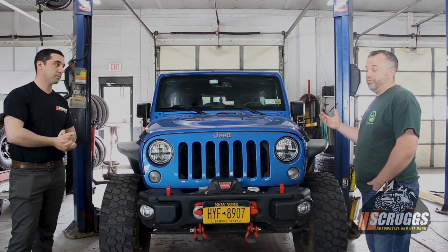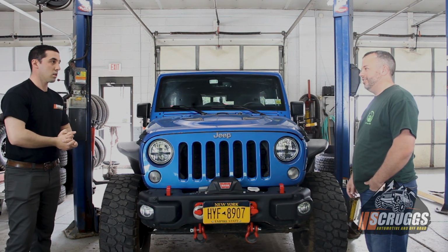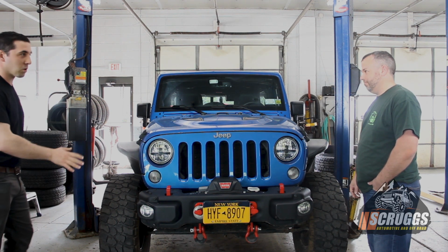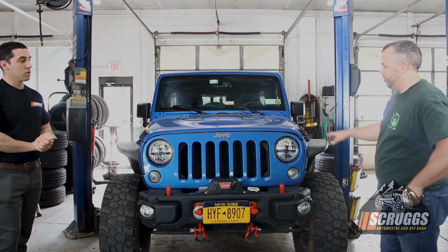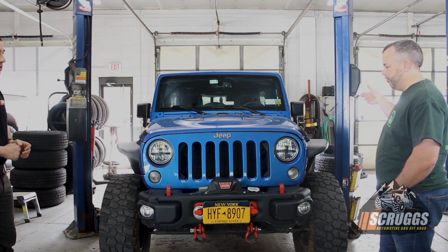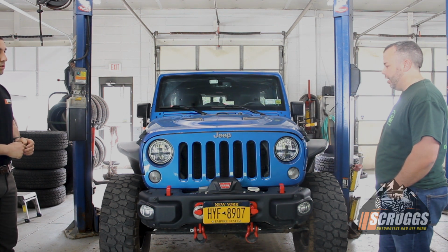I bought it as a wreck, so it has a salvage title, and just spent some time rebuilding it and getting it roadworthy. So you started with it completely wrecked over? Yep. And here it is now in its full glory. So what was the type of damage it had originally when you got it? There was front end damage: basically the radiator support, radiator, front grille, all 4 fender flares, rear door, both bumpers. Luckily the frame was undamaged.